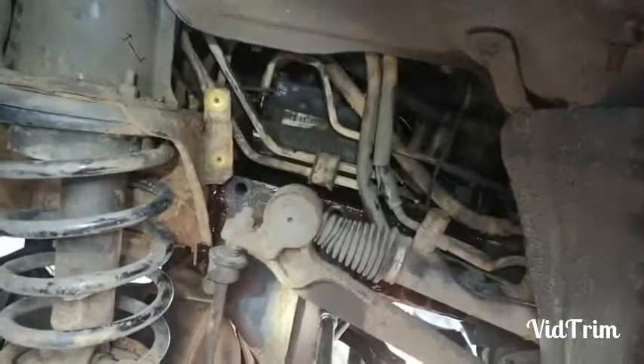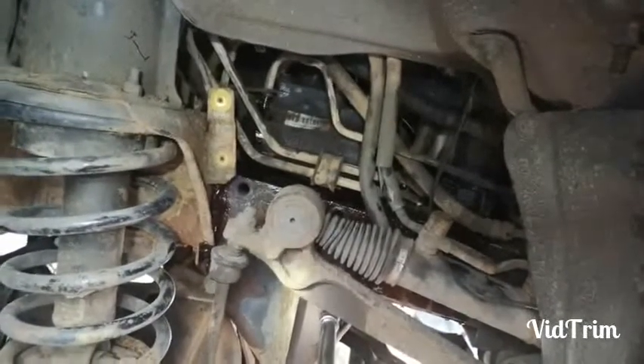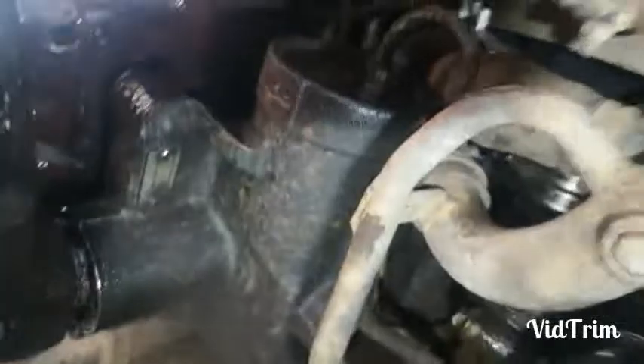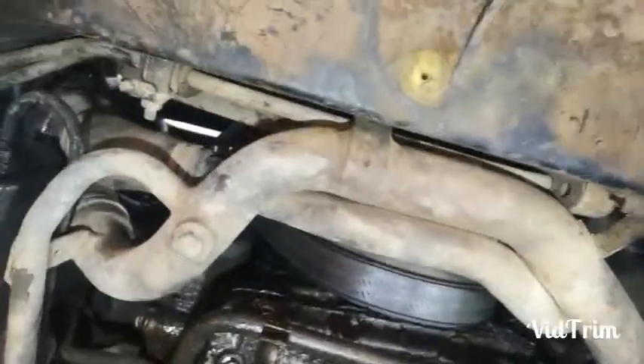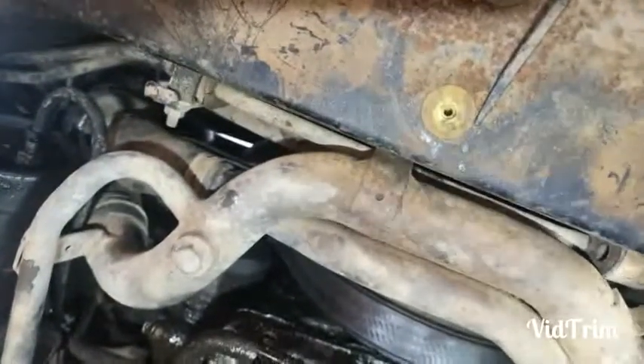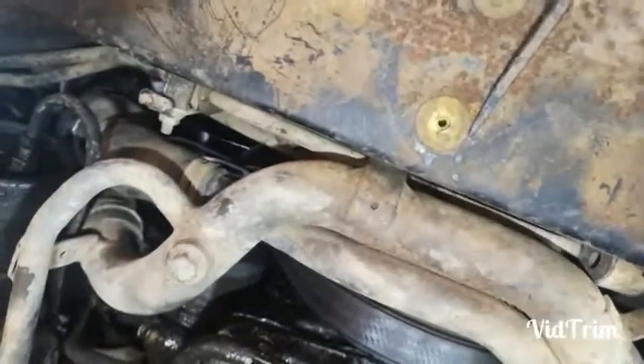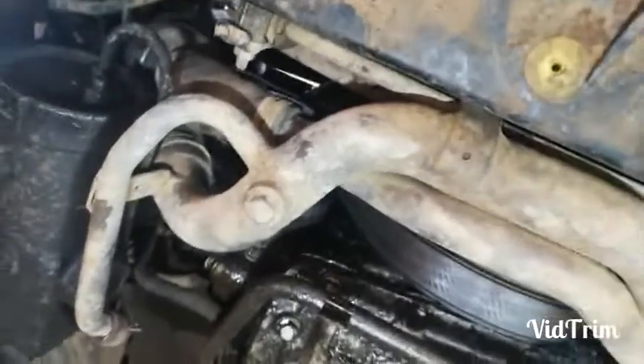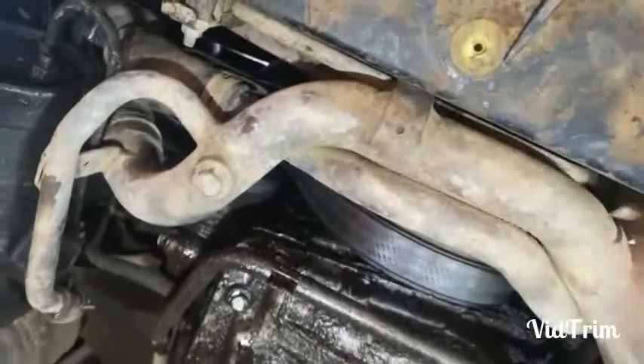As you can see it's got to move now - that's dropping out of the way and it's dropped. There's the steering box; it's loose now, you can see it's moved from the chassis. It's got to come to the left but these water pipes from the bottom of the radiator are in the way. So we're releasing that 8mm there to try and shove these over to the left - if we can do that then we should be able to get it out. We may need to release some of the pipes to let the water out like we did last time.